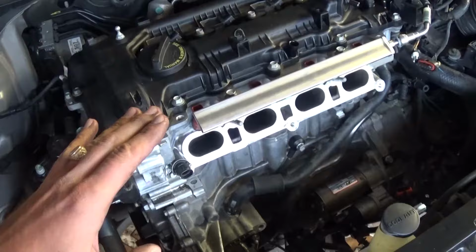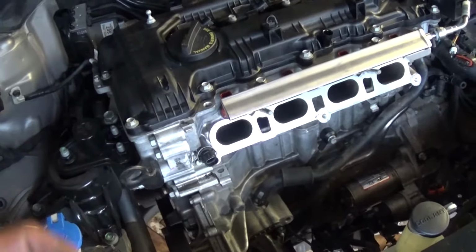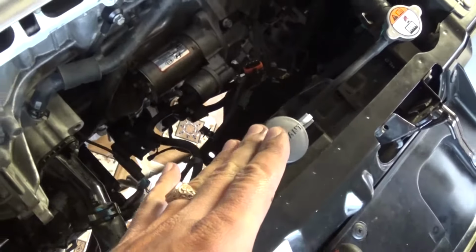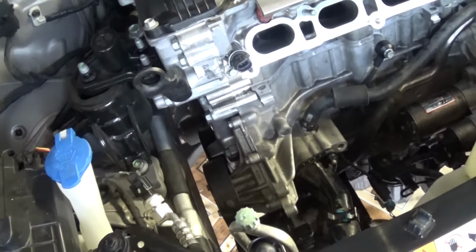It's completely different. First, you have to make sure the coolant is drained. We have the video on the channel. Second, make sure that the car is cold when you do that. Stay away from the fan here, so it doesn't turn on you or something like that. Disconnect the battery, that would be a good idea as well.